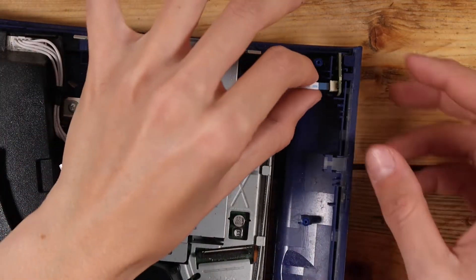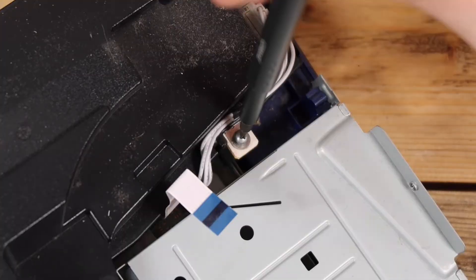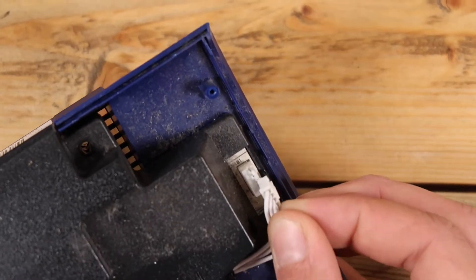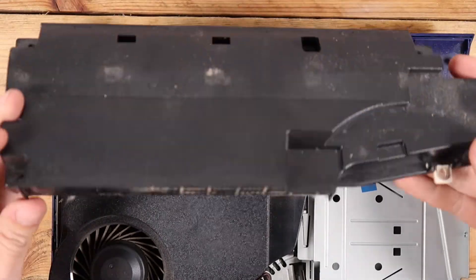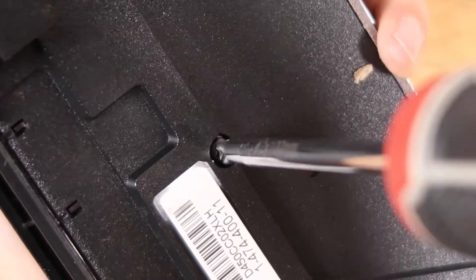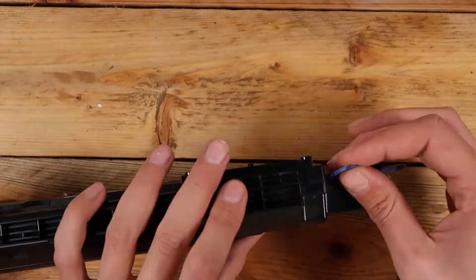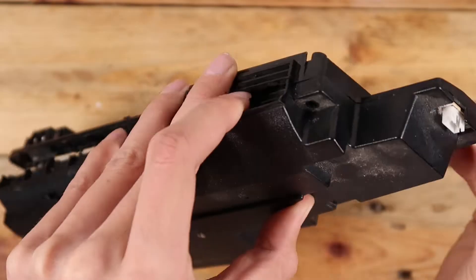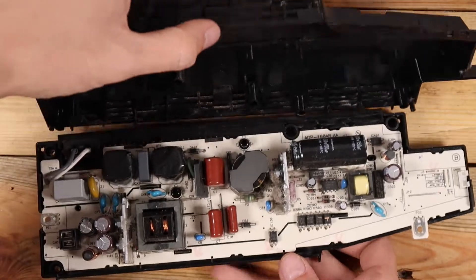The power switch can just be lifted up and out. The power supply is held in by two screws and one plug — with those out it can then be lifted off the main board. There will be some resistance as the underside is directly plugged into the board. The power supply can then be pulled apart by removing the four screws. It is clipped together — the clips are a massive pain to unclip. The area where the plug is just did not want to separate and took me a good chunk of time. After some struggling, the covers can separate and the power supply just lifts out.